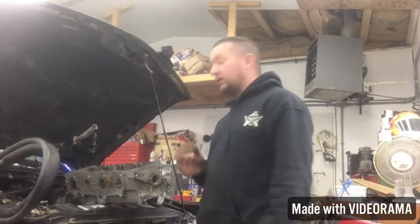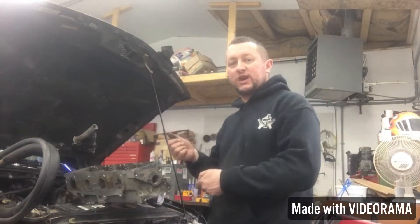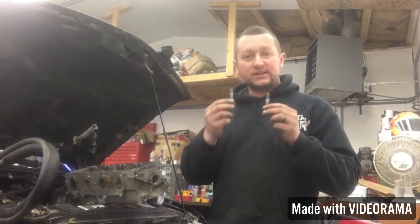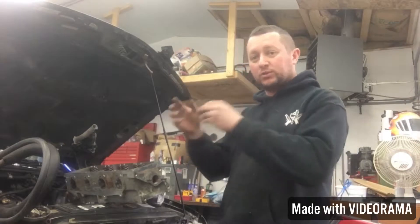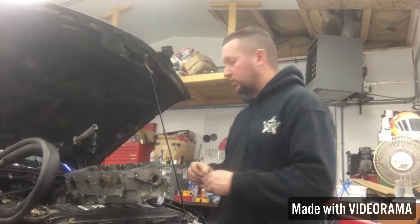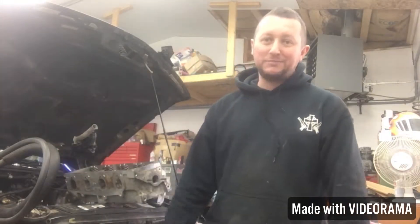We're at the point now where I can put the head back on. One thing to note: when I took the head out, I had to slide it to the driver's side to get it out of the intake. That was because of these two studs — they go through the bottom of the intake to hold it on, and a nut goes on them. I took these out of the head so I can just set it straight down onto the gasket, because you don't want to slide it across the gasket and risk marring it.